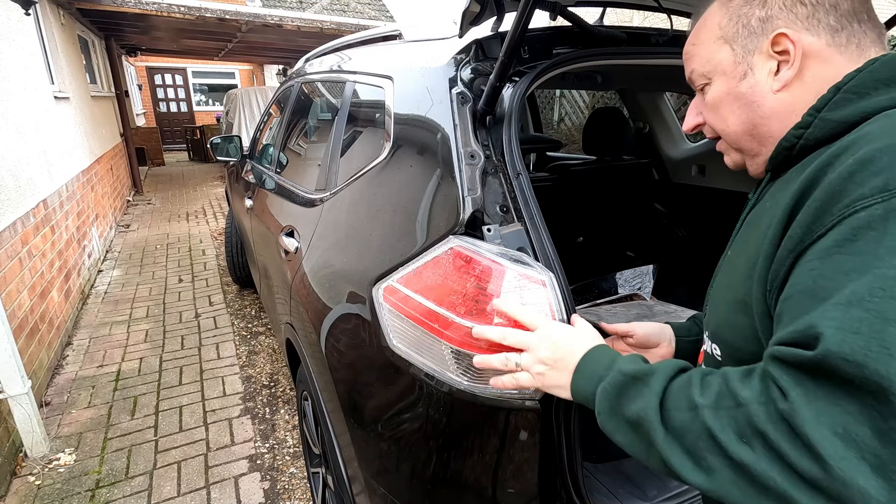That's coming in a different video. Right, let's get this unit back off again. I've got the new bulb here — it says W21W RB, 582. This is a Ring bulb — 12 volt 21 watt basically. Let's get this back off and get this lamp changed. Some of these newer cars — the back light clusters can cost hundreds and hundreds of pounds, so that's one thing to note when you buy a new car. Things like this used to be very cheap many years ago but it costs a hell of a lot of money now. And you do need to take this trim off to get that out, so just remember that as well.